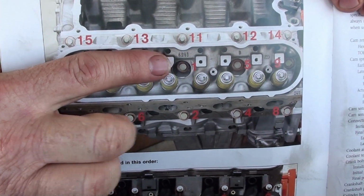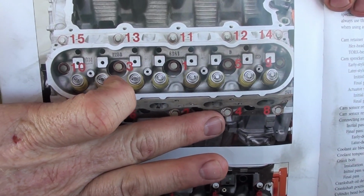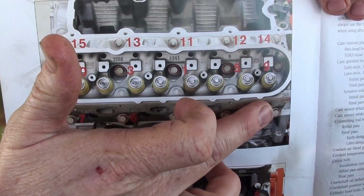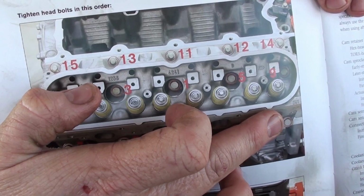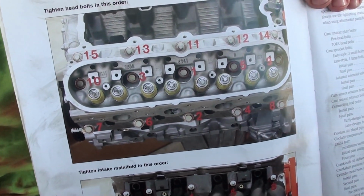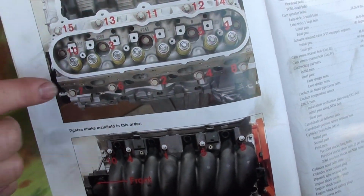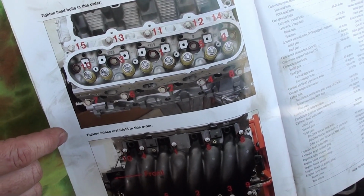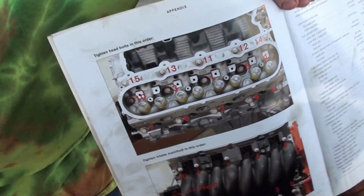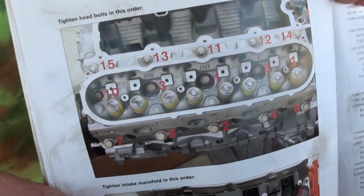There's number one. 2, 3, 4, 5, 6, 7, 8, 9, and then 10. And then you just torque these ones afterwards. Another gentleman I saw on YouTube said that he torques them all up to 70 foot-pounds with these studs. So the first preliminary torque is going to be 30 foot-pounds, and then 50 foot-pounds, and then 70. So that's what we're going to do, or 55 and then 70. So there you go, just a little closer.